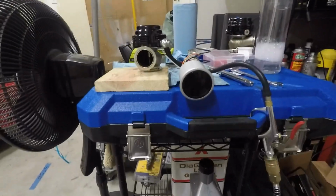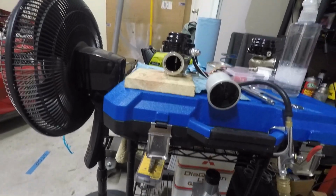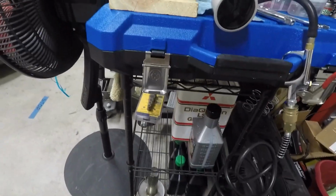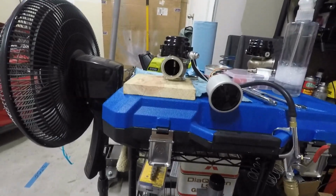That's telling me that these springs are not rated for what they are. So I think I'm going to test each spring to make sure, and then I'm going to find the combination of springs that will work for the setup we have. I'm going to aim for about 15 psi. So as of right now, I think the black spring might be the better choice. But I will pick you guys back up here once I swap everything back out.